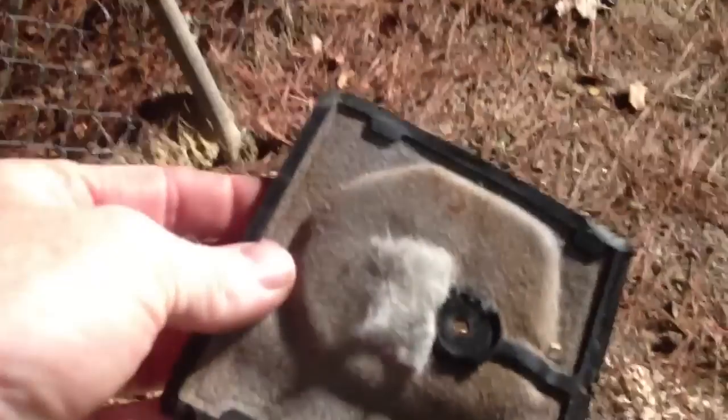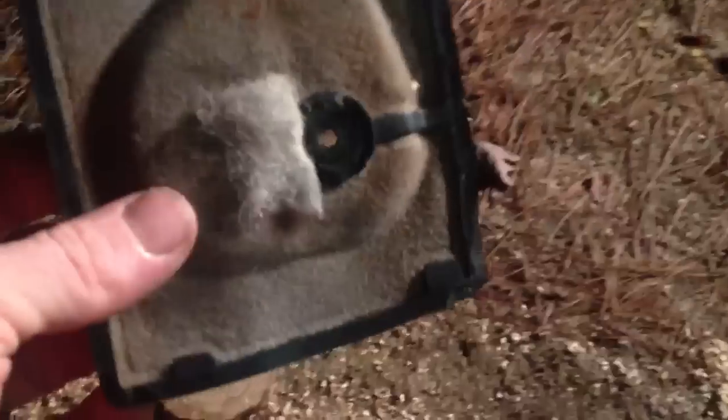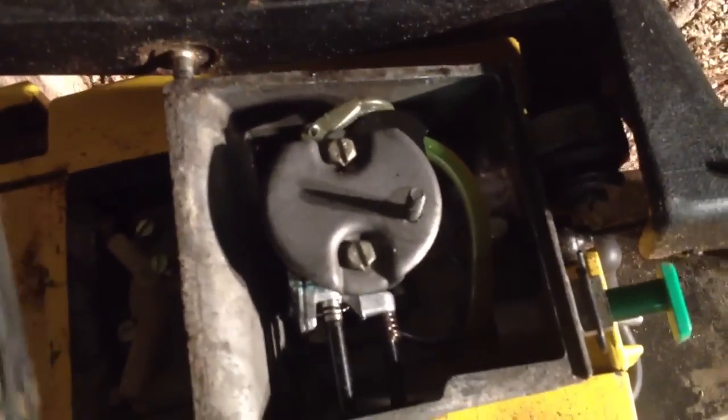The manual oiler works. The choke works. It does have the throttle lock and it works. The air filter is not used up, but it looks like there was a hole punched in it. The previous owner patched it by gluing some fabric over the top of it, but the air filter itself still seems to be good. The air box is clean and it's got a new fuel line.